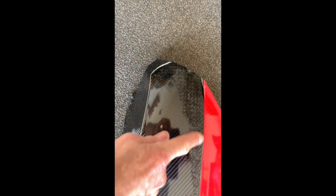Two side covers done. And the bad news is too much water or isopropyl mix damages the finish of the carbon fiber. This looks like it gets underneath it and lifts it. It could be because it's a cheaper product. It could be too much alcohol, so I diluted the alcohol down to 70-30 as Kevin suggested, and tested it on a piece, and I did it again, still did it. So then I used it, but I tried not to get any on here, but I got a little bit at the end there, you can see. That's not worrying me too much. This looks a bit yuck. So this means it's a redo.